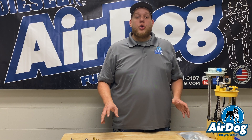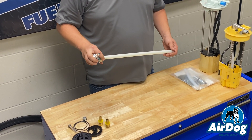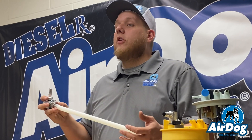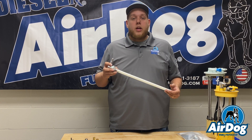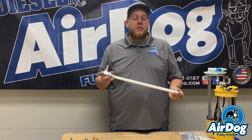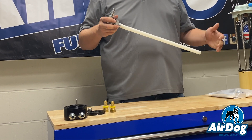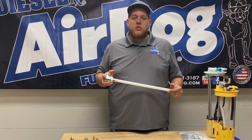Whenever you purchase an AirDog unit, it's going to come with everything needed to install it on that truck — whether that's a draw straw or fuel module upgrade. It depends pump by pump and application by application. If you have any questions on selecting the easiest pump to install or what's best for you, feel free to reach out to us directly at our tech support. One big thing to note: the number one killer of an AirDog pump is inlet restriction or cavitation damage — meaning the customer did not install their supplied draw straw, fuel module upgrade, or sump depending on the install. Always install the proper suction from your tank with your AirDog unit. We can help you pick what you may need, but just verify you're installing these properly.